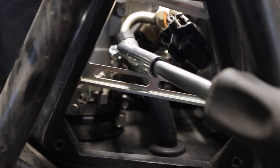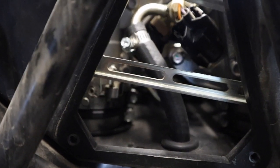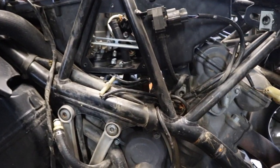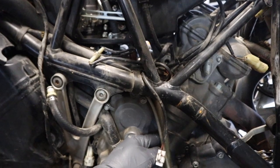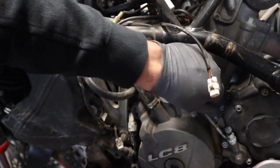Next up, we want to unhook this fuel line clamp. There might be a little bit of pressure on it, and you may have a different clamp on yours. I'm the third owner of this bike, so who knows what fasteners are on there. Now we've got the fuel line disconnected. With the fuel line removed we can see we've got this clear drain hose that comes down off of it. We're not going to need this when we put the new airbox on, so I'm just going to fish this out a little bit and pull it off.